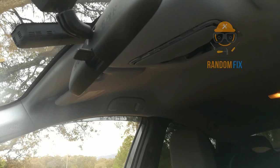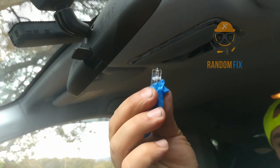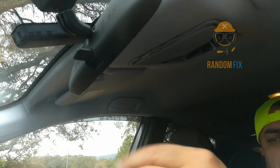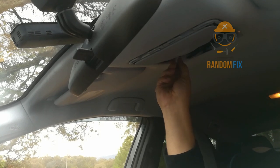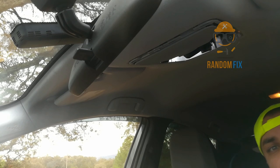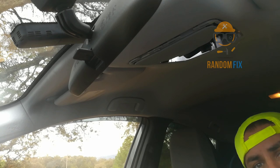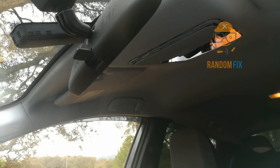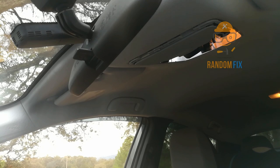These are really hot — that's why I'm actually changing these out, because they burn up. I went ahead and got the first light bulb out for the dome light, and here's the replacement: it's an LED with a total of five lights instead of one. It takes a lot less energy and doesn't burn hot or burn up the socket. One thing with these — when you put them in, if they don't work, just flip it around because it has a positive and negative, unlike a regular bulb. This one is a lot brighter and doesn't get hot; the old one is unbearably hot — you can't even touch it.